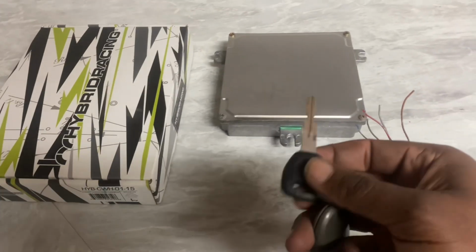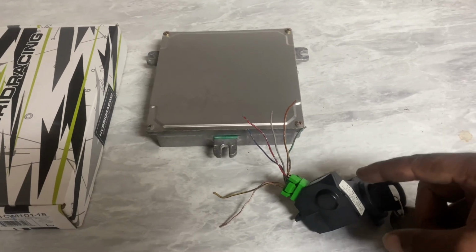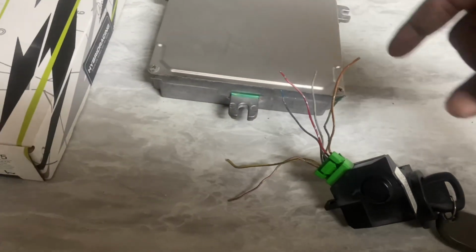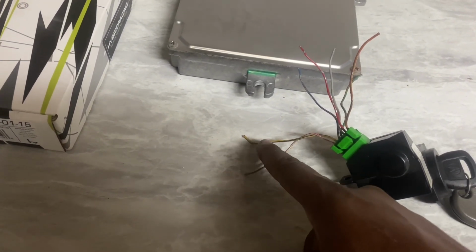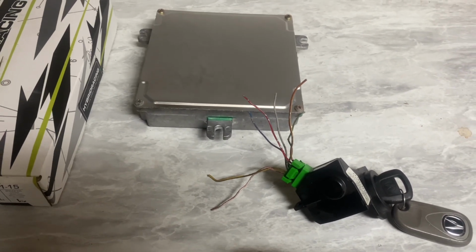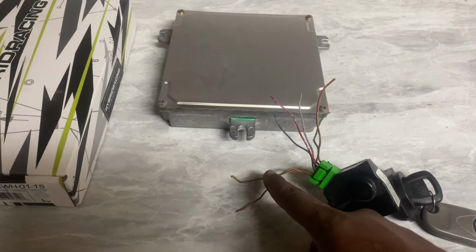So the little immobilizer chip inside of here goes inside of this, and this is usually in the ignition, and this sends out the signal, which is this red and blue wire. The rest of the wires, we got this red and white wire and yellow black wire. I usually combine those two and just put that on a switched power, which I'll probably show in the next video when we show you everything that you need to do to get a K-swap running. So those are our 2 powers.